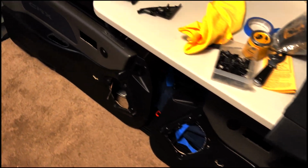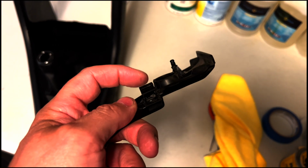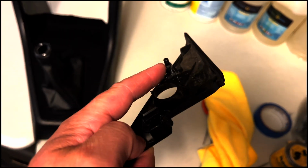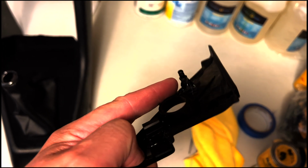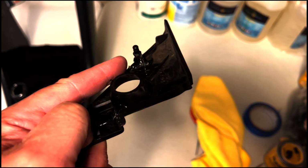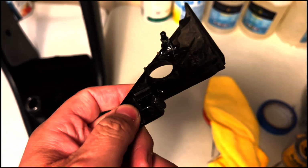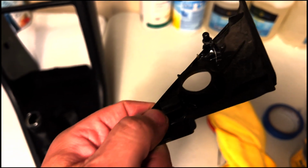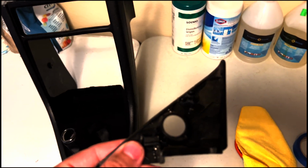And then the other thing that I did was I just kind of repaired the sail panel. Both the clips were broke. This clip here was broken completely off, and then this kind of fell apart because it was really stuck in there. It's a little push pin, and I had to use some little pliers to yank that out and then kind of reapply it. Again, I used some CA glue, and then over the top of that, I used some E6000. So hopefully that will hold our sail panel together.